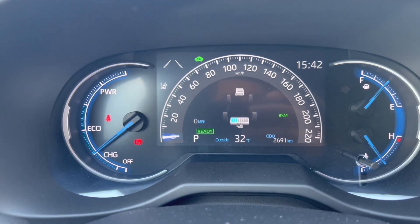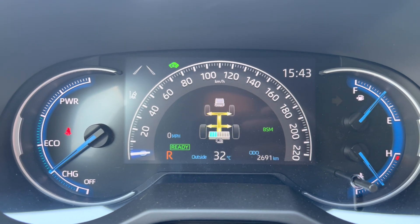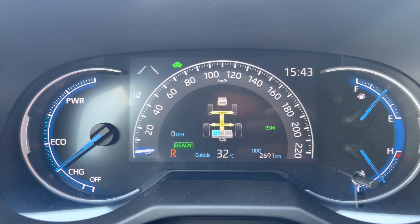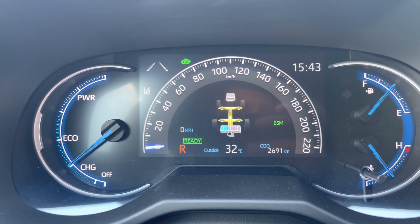I'm inside this 2022 Toyota RAV4 Hybrid XSE. Typically, on startup, at idle, or at very low speed, you're only going to be using the electric motor. The combustion engine will not kick in. The same applies when you're in reverse — a power control unit shuts down the gasoline engine in these situations, so it's just the electric system running the vehicle.